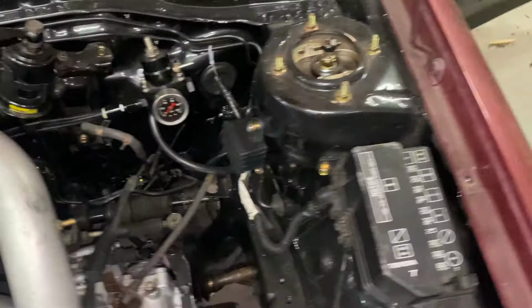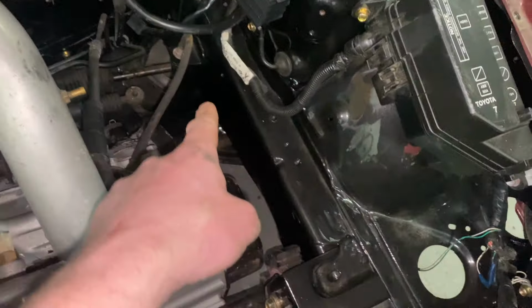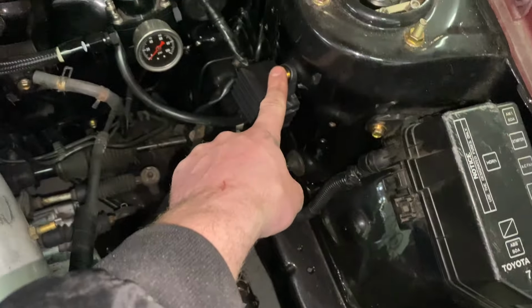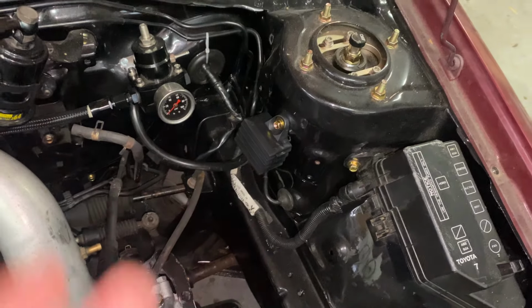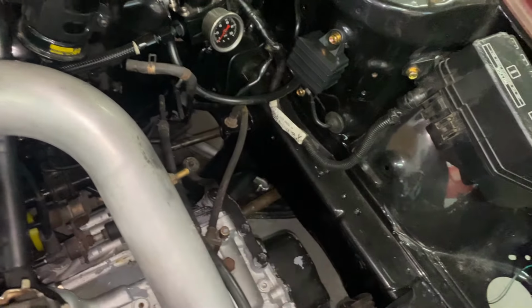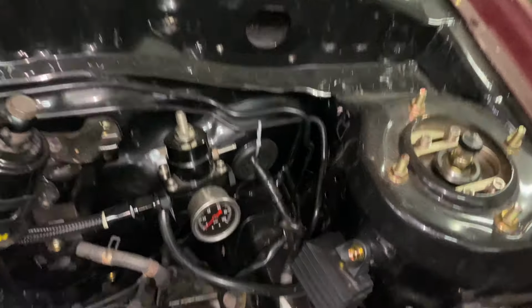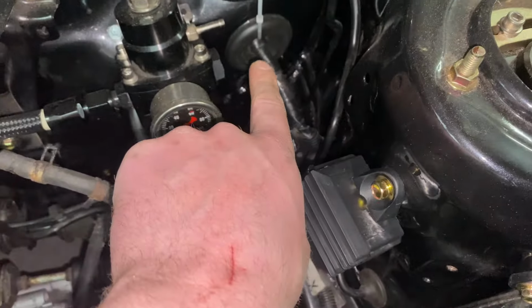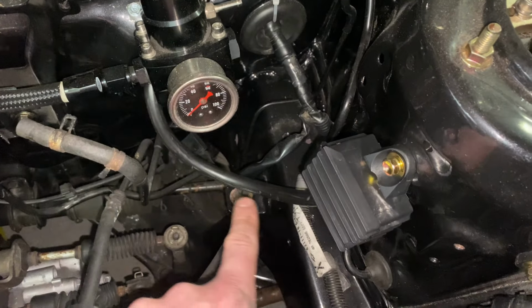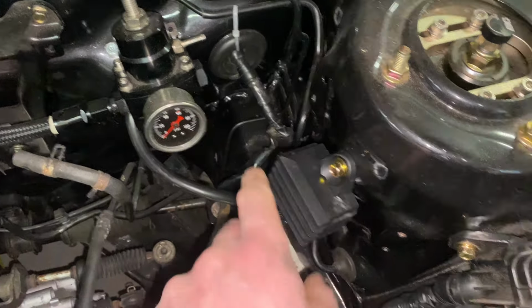This is kind of a little bit out in the middle of nowhere, but see that hole there, that threaded hole is in the car. I didn't have to drill that. There's also another one in the chassis leg down there that I could use. And another thing I was thinking was I could possibly cut a little hole in this grommet here and take my power cable up and feed it through this one and get a straight link into this box here.